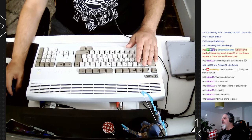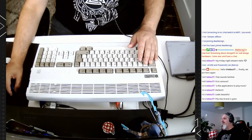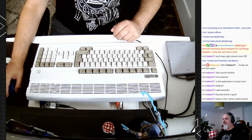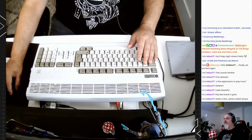So we are going to go to AmiNet and let me search with the word Vaio and see if that will give me the driver. Okay, PCMCIA CD.LHA, ATAPI PCMCIA CD driver Sony Vaio. I think that's the one that we need, and it has here the model that I'm having. The driver was created by Aidan Holmes. And yeah, let's give it a try. This is version 1.4.